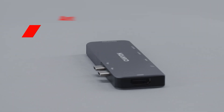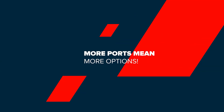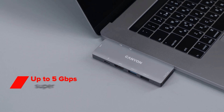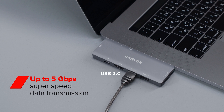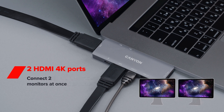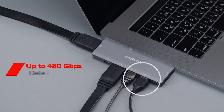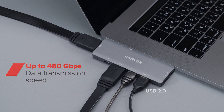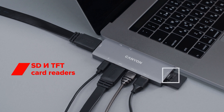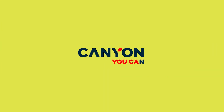You can also use it as a docking station or a stand by putting your laptop on its upper edge. Ports include: HDMI port for 4K 30Hz; 3.5mm combined audio jack for microphone and headphones; two USB Type-C ports with 60W power delivery charging and data transfer; two USB 3.0 Type-A ports with up to 5Gbps high-speed data transfer; Ethernet output at 1000Mbps; highly durable aluminum casing; plug-and-play usage with macOS and Windows; compatible with all USB Type-C MacBooks, PCs, and laptops. Product size: 226 x 33.7 x 24mm.